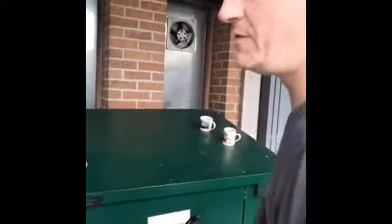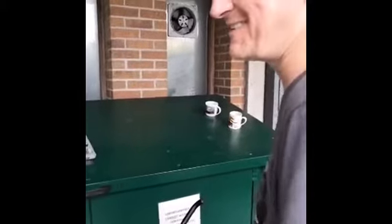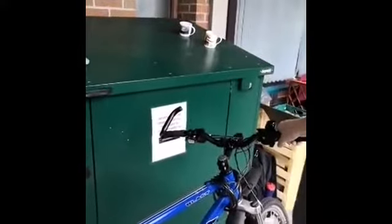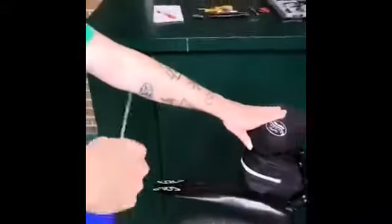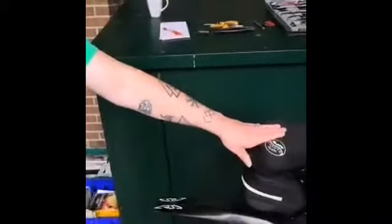So it does that. If I push the gear lever all the way, it'll actually skip down multiple gears. And I don't think it should do that, should it? No, usually not. But if you keep pushing it, it will. You can push it just one click, but if you push it further, it'll go down there. You should only be pushing it enough to change one gear at a time. If you're pushing it past that, it will change further.